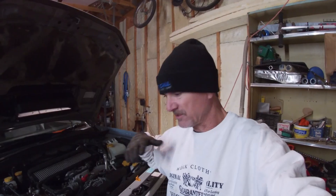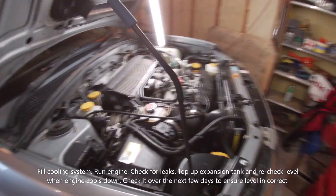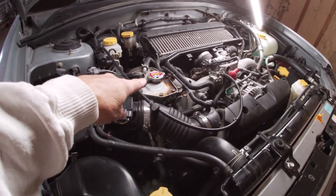Don't plug it in until you've run the engine for about 10 minutes, making sure all the air bubbles are out of the system and the coolant level is full and everything is good. Then you can plug it in — you'll hear it sizzle as it comes on. If you have any questions or comments leave them below, thanks for watching. And there you go — about an hour's worth of work. We've got our cooling system filled up.